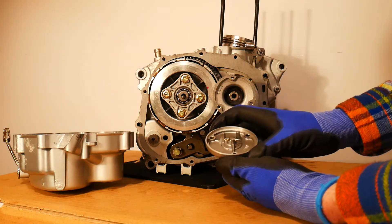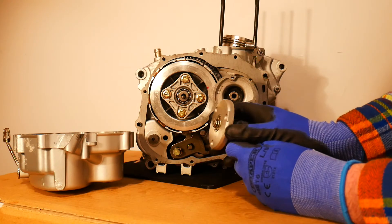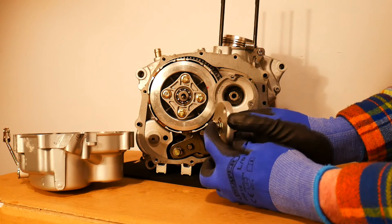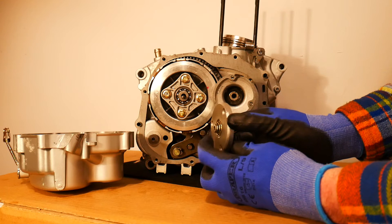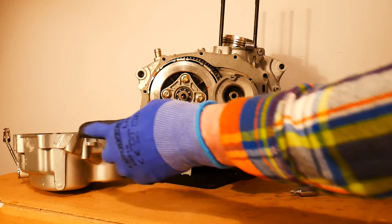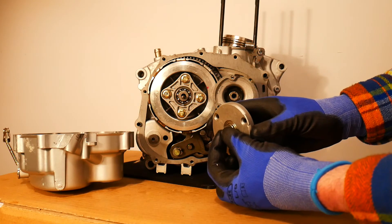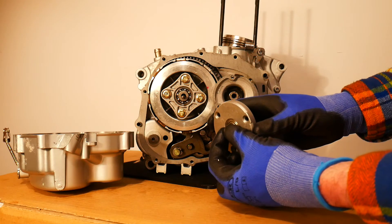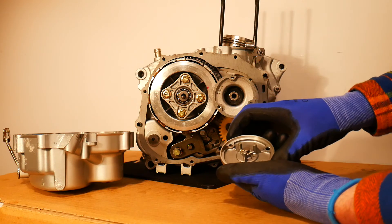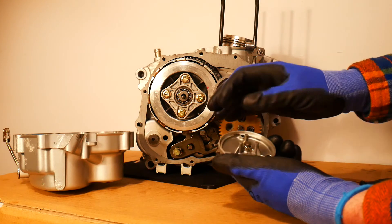In the cap we can see the little valve. The valve is on a spring - that's a side view - so the valve is on a spring and you can see that it moves in and out. The spring wants to push it out this way. When you put the clutch cover on, the hole on the clutch cover will push on this so it matches up perfectly.